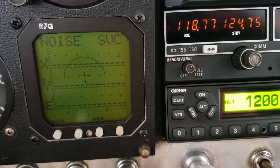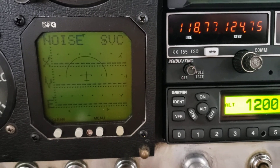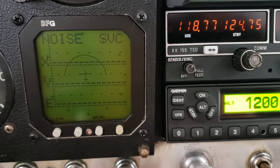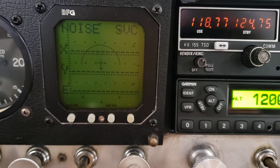According to this test, there's not enough noise to cause an error code five now that I've moved the G5 wires off of the antenna wire. You're really not supposed to route them directly on it, and by moving those away, it looks like it solved the problem. I'll take a picture of that once I get out there.